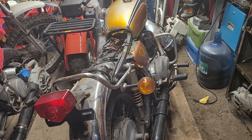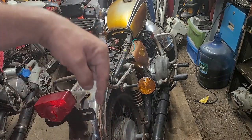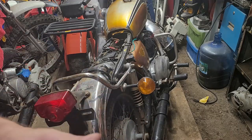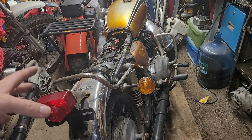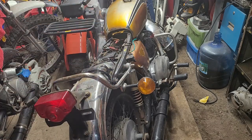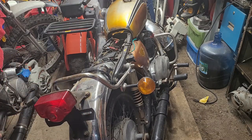The carburetor bowls are flushed and filled up. I'm not taking apart these carburetors yet — the only reason is because the fuel that came out was definitely varnished, but it wasn't to the point where it looked totally gummed up. It was still liquidy, not thick solid gum like the tank looks. The tank looks awful, but I think the petcock was off and it leaked through, while the carburetors just had a little fuel left in them. When I pumped them up I got a bunch of crap out.